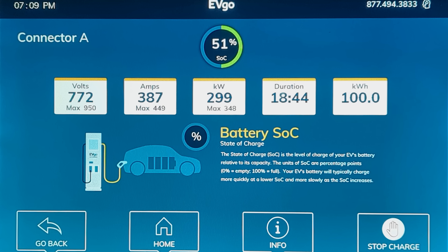You may notice the screen says the session ended at 79% state of charge, not 80%, but that's because there's sometimes a lag between the actual state of charge on the vehicle and what the vehicle sends to the charging station. The Silverado was set to charge to 80%, and when it reached 80% it stopped charging before it notified the charging station. I confirmed in the vehicle that it was indeed at 80% state of charge.